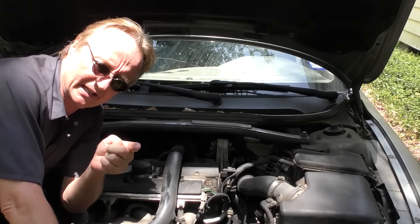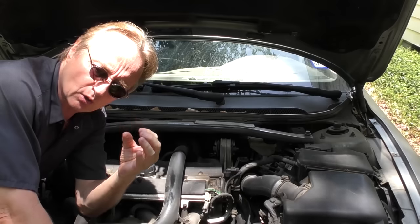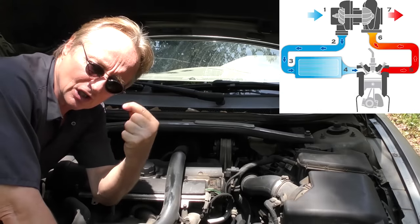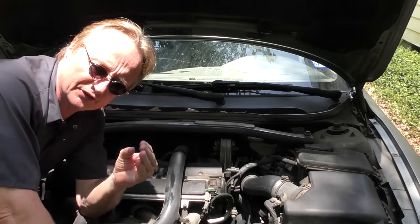The third tip is also oil-related: use high-quality oil and change it frequently. This is where full synthetic oil is best. Full synthetic oil works under hotter temperatures — and your turbocharger uses hot exhaust gas to spin itself, so it gets super hot. If you've got a turbocharged car, definitely use full synthetic oil and change it every five to seven thousand miles. Some turbos will almost start to glow from the heat they generate at high speeds.